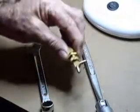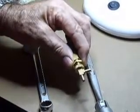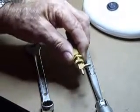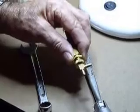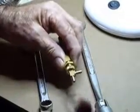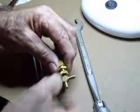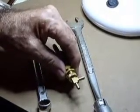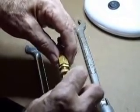I put that into my vehicle when the ball stopped rattling and took it for a drive and got five psi. So I came back and went up about two turns and finished up with just over 20 psi, then took it back slowly until I now have 18.5 psi. That really hasn't changed since then — the heavy-duty spring allowed me to get that 18.5 reliably and it doesn't appear to have softened at all.